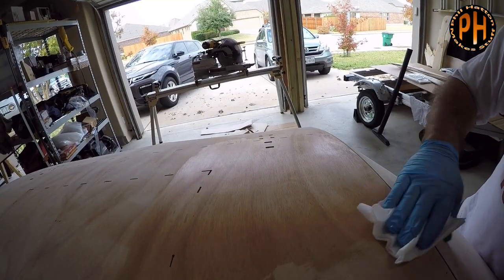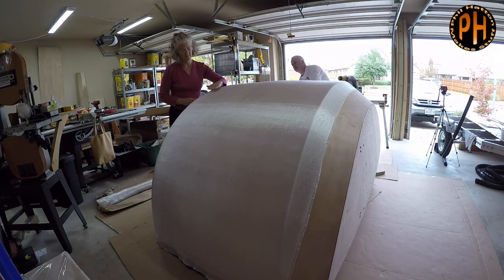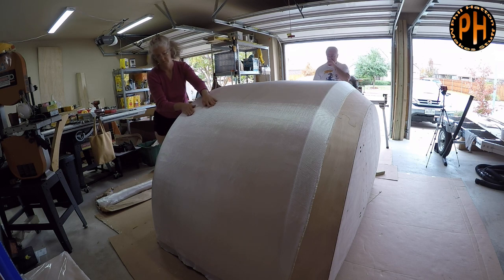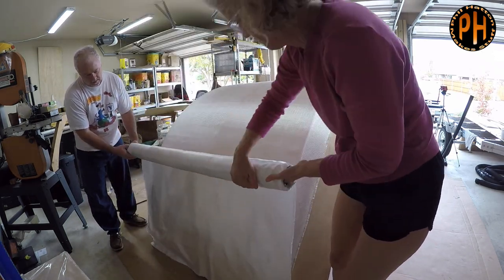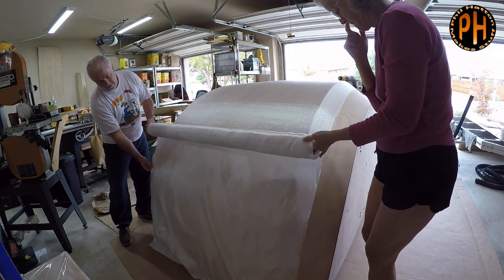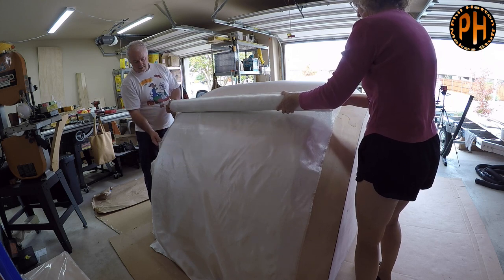We used denatured alcohol to clean up any dust and prepare the camper for fiberglass and epoxy. Then we draped the camper in cloth. The top of the camper gets two layers while the sides get one, which overlaps the top. The most challenging parts are the overlap between the top and the sides and the corners down near the bottom. Fortunately, fiberglass is forgiving. We found stroking the fiberglass helps it conform to the shape of the camper. Gently petting the fabric and having the patience to leave it to take on its new permanent shape will do wonders to let the wrinkles fall out.